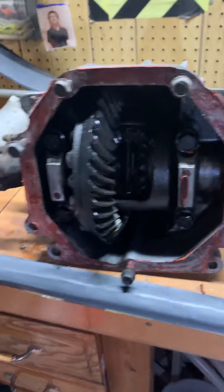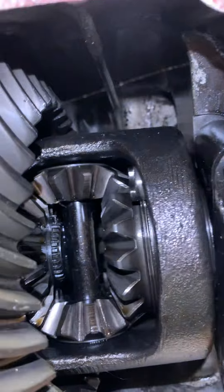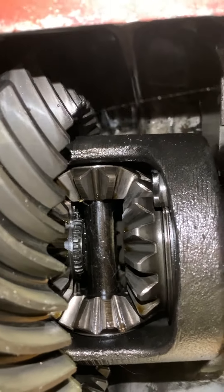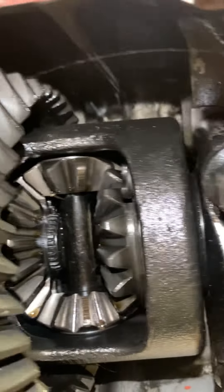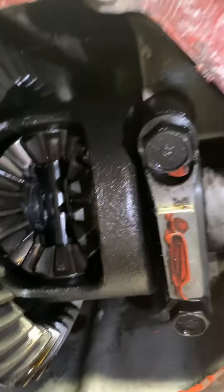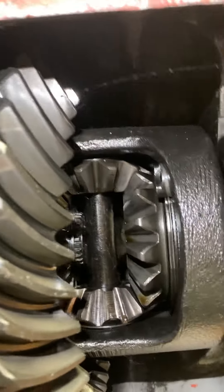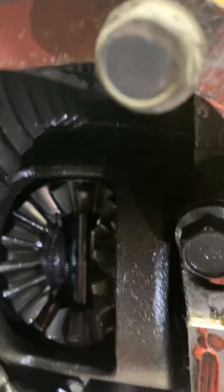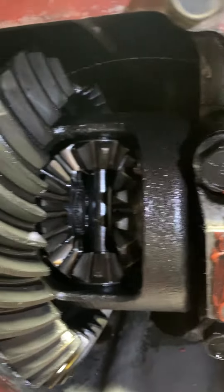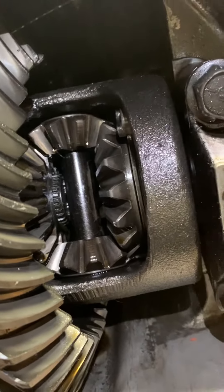As far as the C4 is concerned, the geometry of the suspension just jams these axle stubs against that pin as a matter of design. Any added tension — like doing donuts or a burnout — will exacerbate potential issues. It is such a rare problem that I have not seen many others that look like this.